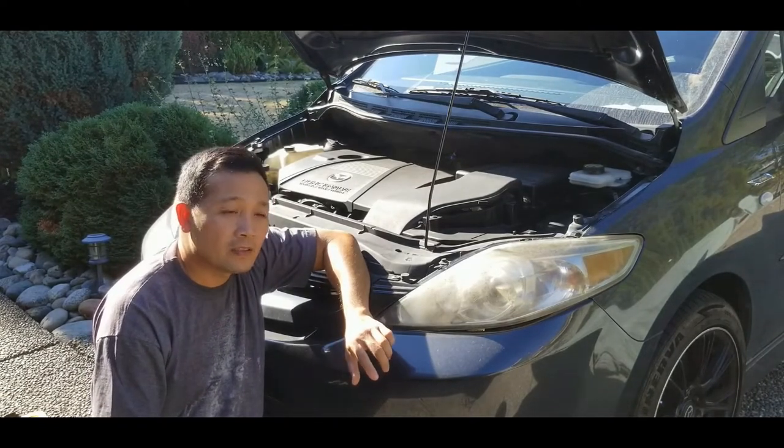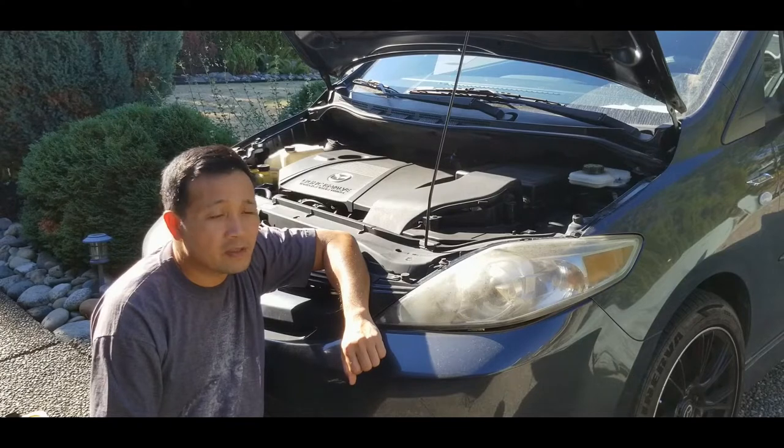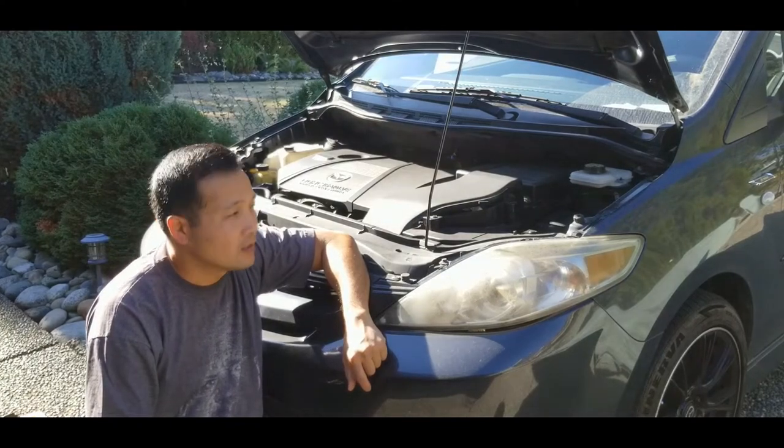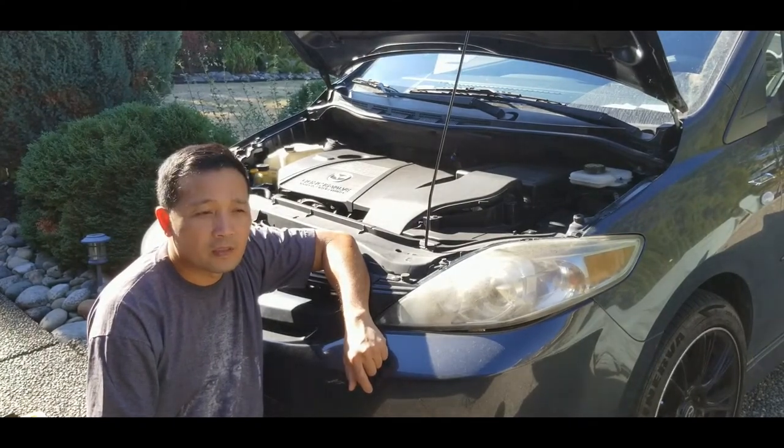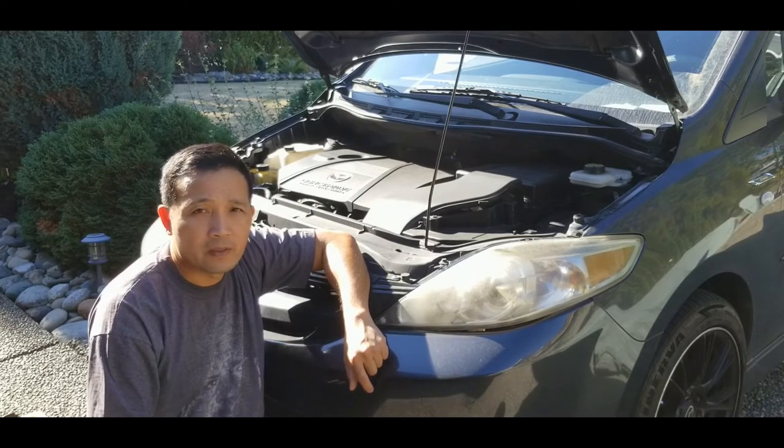Today's video is about my daily driver, a 2006 Mazda 5. It's developed a rough idle issue, which is a common problem with the Mazda 5. There's actually a bulletin about it, which says to clean the throttle body. I did that, and it didn't solve the issue at all.